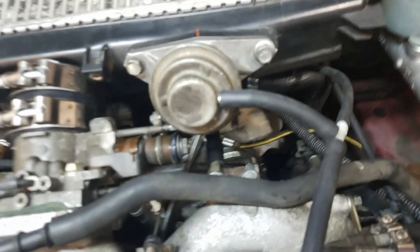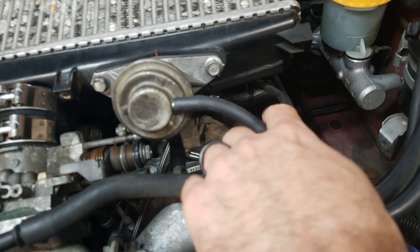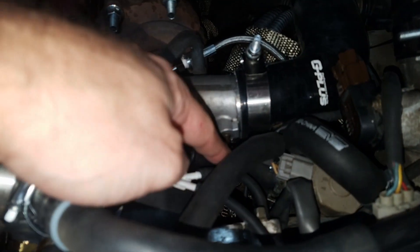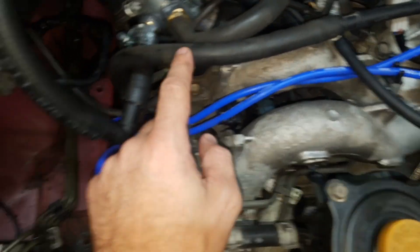I can go over the vacuum line while I'm over here as well. This is the vacuum line that goes to the blow-off valve, and what's going back here is to my actual boost gauge in the car. This is vacuum line — we're going to trace it all the way down. It actually runs to right here. So I installed a Y here to Y off — this line would just normally go right into the block or the intake manifold. So I Y it off and that's where I get this, and then it Ys back to where it would normally go.